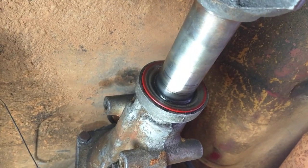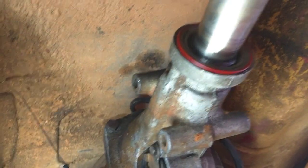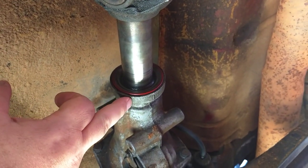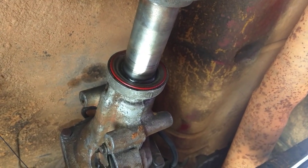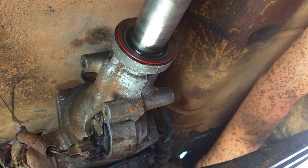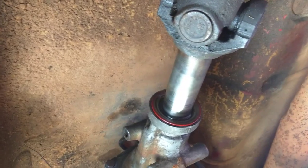Dean's Transmission here in Foley, Alabama said that from the dimensions I gave him, as long as it went into that component — I don't know if it's a shim or what it's called, but it comes with the seal when you buy the tail housing — it should be okay. I actually watched them put the driveshaft in and it went in about an inch to an inch and a half. I'm not comfortable with it. I'd honestly rather find another tail housing — this part here — that's longer. I'm going to measure it and do some research because it would be really easy to install.